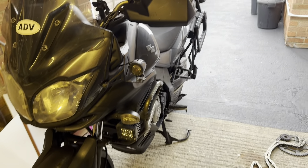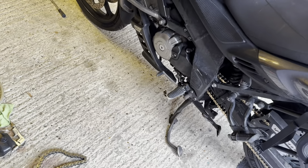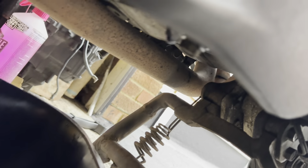When I bought this bike about a year ago it did have a new chain and sprocket kit on it, and I've done nearly 20,000 miles. They should last longer than that, but there are no o-rings visible — whoever did the job before didn't fit the o-rings on the connecting link. That's why it's worn out. You can also see there's rust: as soon as a chain starts showing orange from any link area, water ingress has got in there and worn it out. So, new chain and sprocket kit fitted, and now an oil change before the trip.